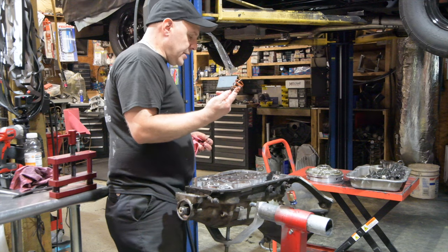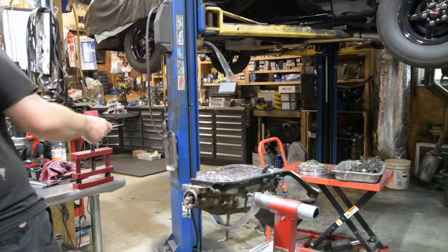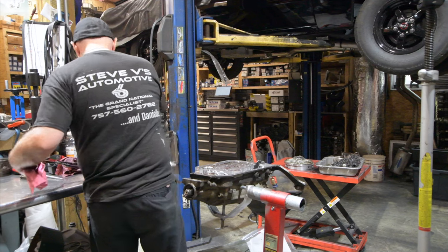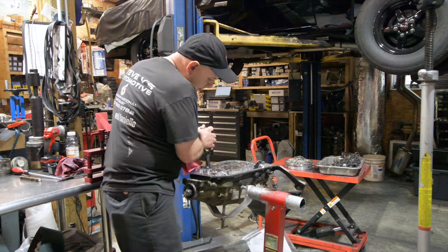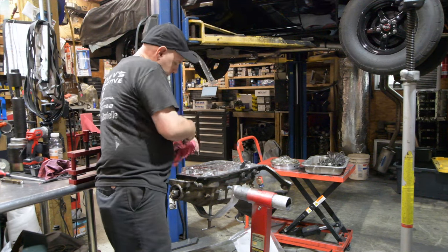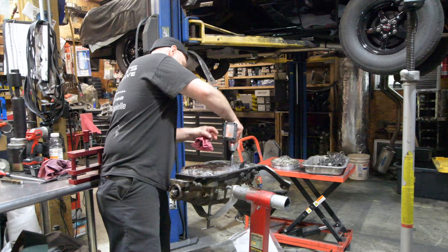These springs also break. This is the 3-4 accumulator spring. Now we're going to make a mess. And I stand it up. Before I do that, we've got two things to do. We're going to get this 3/4 accumulator piston out. These guys leak too. And we're going to get our 10 millimeters for the center support.